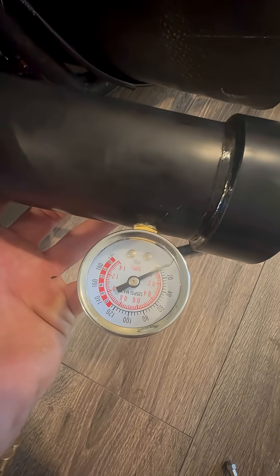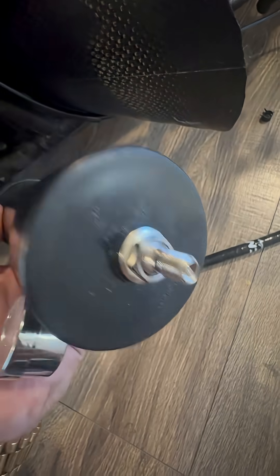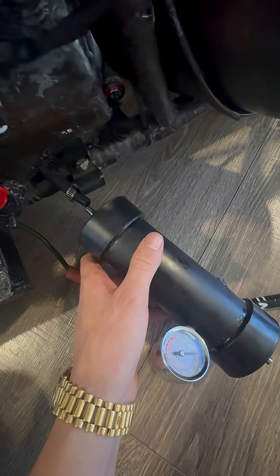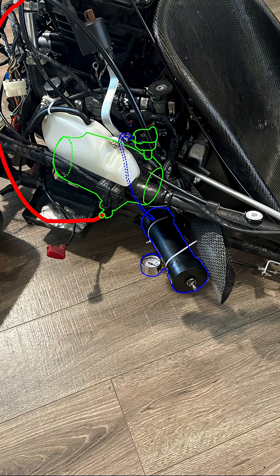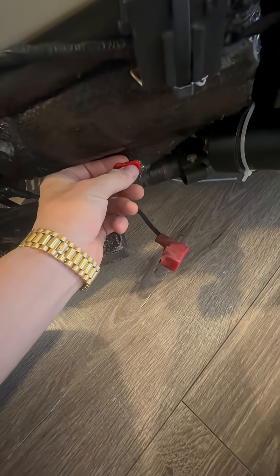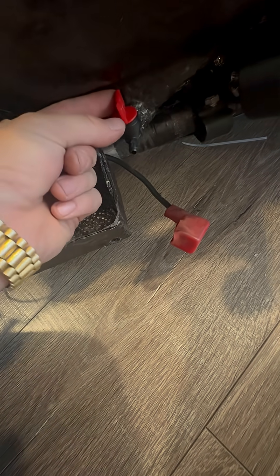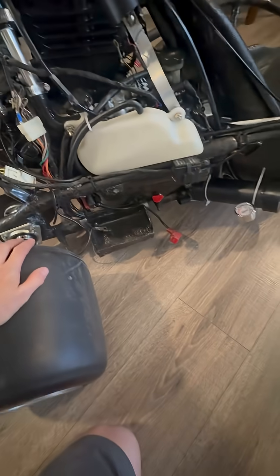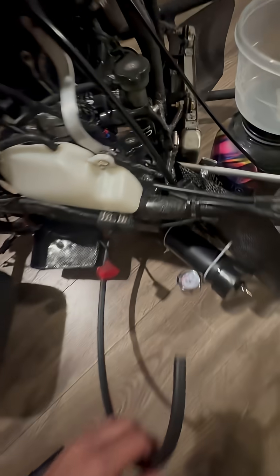This is the air tank that I made. I'm only going to need about 20 psi. I put a tire stem on this side to fill it up with air, and a tire stem on the other side, and I took the valve core out of the center so it's just going to be hooked straight up to this. This carbon fiber gas tank sounds a little bit insane while pumping it up to like 30 psi, but it should take it — the stuff's really strong, it's just known for sounding creaky. All that pressure is just going to push the gas up to the carb.